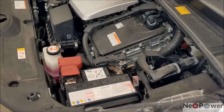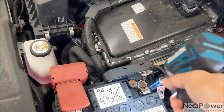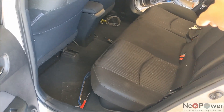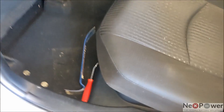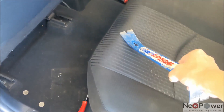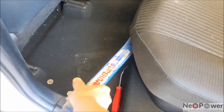Before you start, first thing first, disconnect the 12V battery — it's a 10mm. The second thing is to take out the seat. The battery is actually under the seat for generation four. To take out the seat requires some force — this is where you take out your persuasion bar. There are two latches. Once you find the latch, give it a push and one side will pop up. You basically have to pry this out. Same thing on the other side.